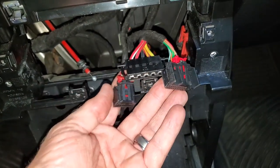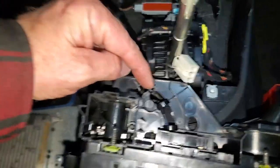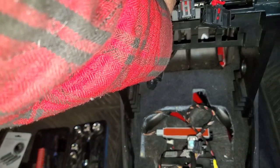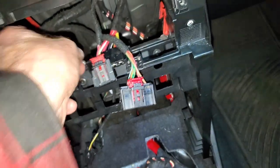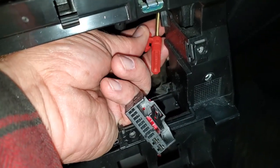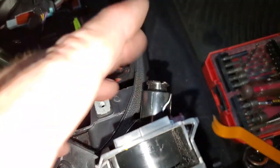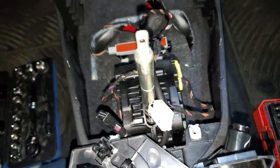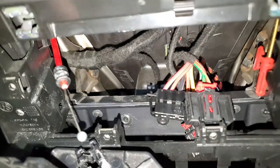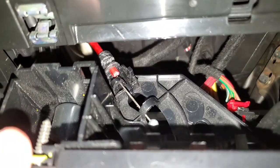These are the cables that go to the back of the climate control module. The cable will be pushed down and snapped into position — the ball needs to go under here. Before we install it we want it pushed in, then we can pull it out. This rod or cable goes into this unit on the back of the climate control module — don't forget it. I extended it so I can thread it through the little arch. As I slide this in one-handed with some twisting, it's through and guides the cable into place. A little hook goes over top of the cable holding it in place and we're below the arch.